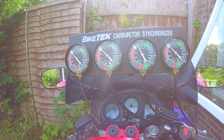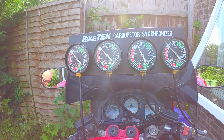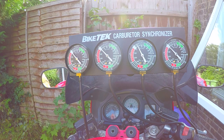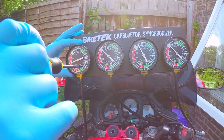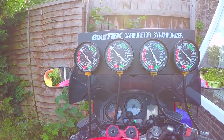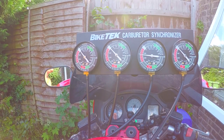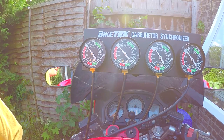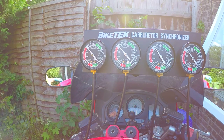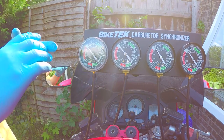While I'm going around the other side, I'll keep on talking. The beautiful thing with the VFR is that cylinder one is a non-adjustable cylinder for the valve, so it's a perfect opportunity to use cylinder one to synchronise them all. It's going to get really loud because I'm about to start the engine. I'm going to put two over that side, two over that side, and then screw the lids back on. So they're now calibrated, and quite honestly I'll probably do that each time I use them.